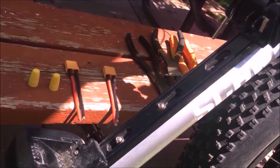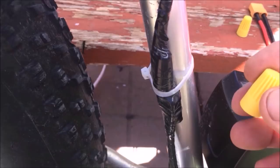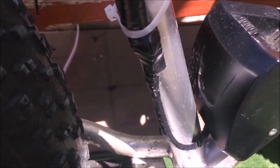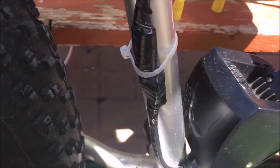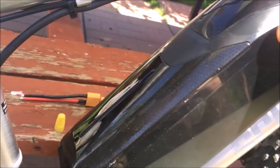When I connected these wires I used household Marrettes — I always use these because I change everything so much. To keep water out, I tend to orient one connector like this and one like this above each other, so if they ever get any moisture it just drips out. Then I wrap them up really good with black electrical tape. There's another option though — XT90 connectors. There's a male and a female. You can see the wires are very thick compared to what would be on the bike, which just goes to show how much overkill they are. So after you get it mounted and wired up, you just drop the battery in the cradle — there's a key on the other side that locks it down in place. When you put the battery on, always tug it really good to make sure it's locked in place.